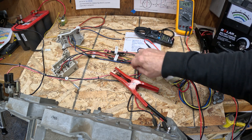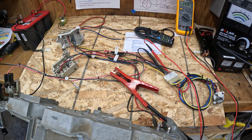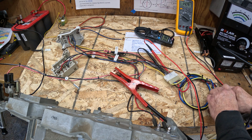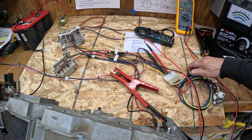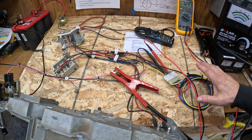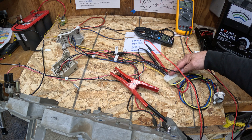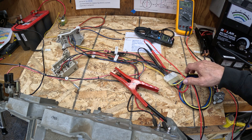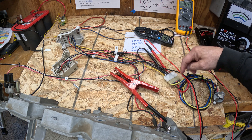The heater, AC, and blower motor — almost anything that's key operated — would be powered off this circuit. I've tapped into this pink wire so I can get a load on this splice. This requires the ignition switch to be in either the on or accessory position — we're going to go to ignition on. The load is set to about 12 amps. I'm using an NOS switch and don't want to fry it, but I wanted to demonstrate that even a brand-new switch with new Molex terminals should be at its maximum performance.